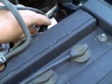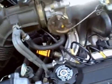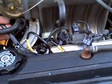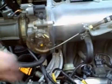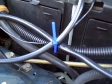Now that we've got them all connected, we're going to double check all of these. Those are all done. You did a great job there Ryan. The last thing we want to do is make sure the wires don't touch anything hot. There could be hot components in the engine that could melt the wire, so make sure it's not touching exhausts or anything that could cause a short circuit. Grab a couple zip ties — put one right here and one back over here so that the wires don't just hang.